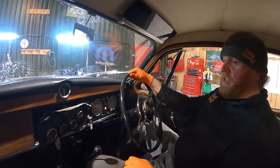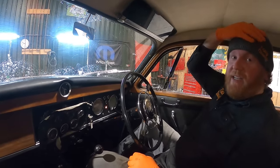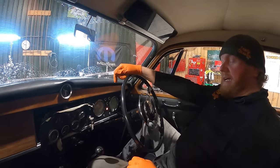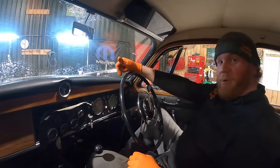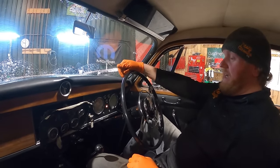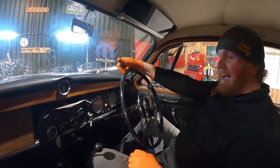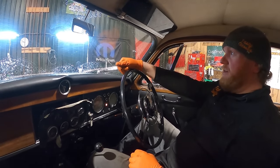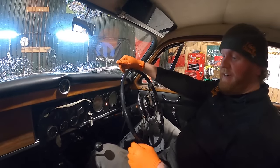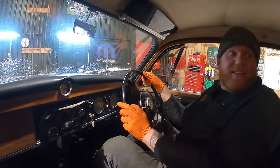Situation, we just didn't have brakes, but now we've got brakes because I've just bled it manually with Aled's help. Those brake bleeding kits, they're just not as good as a foot pumping, you know. And the battery sometimes charges and sometimes doesn't, and we're misfiring, which I think is the points again. But headlights work, wipers work, let's go for a spin.